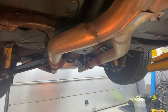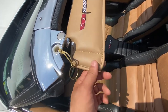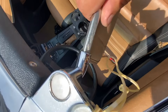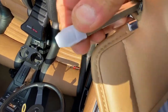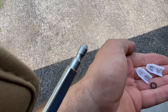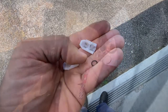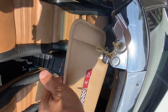It's the simple things that make your car run better. We have a floppy sun visor — that's what the rubber band is here for, to hold it up. Let's see if we can tighten this up. This little clip you've got to pull off, get that off, pull out the clip, and this whole assembly should just slide right out. It's held by this plastic piece. I thought he had a new one floating around but I can't find it, so we're going to try to tighten up this one. I ended up putting just a little piece of an O-ring in there because I couldn't get it to jam in with the full O-ring, but that's better than it was.